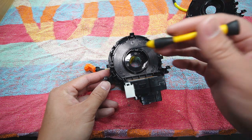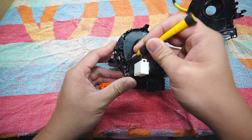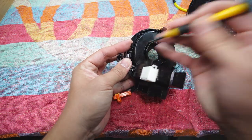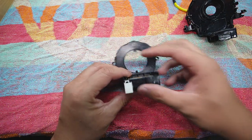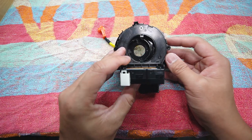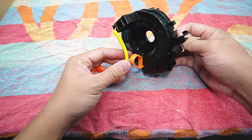We're going to be removing this entire sensor piece. There are a bunch of tabs holding it around — I'm just going to go around and pry them off, gently. You don't want to break it. As you're prying the tab open, just gently pull it up from the sides. And that's the new piece which is going onto our aftermarket clock spring. Slot it straight over, push down, and that's your clock spring ready to go.